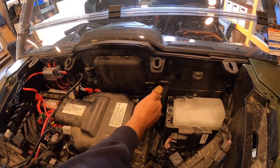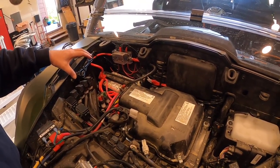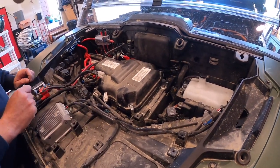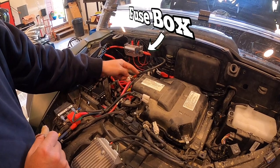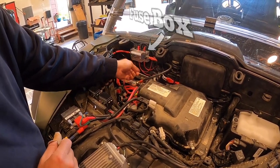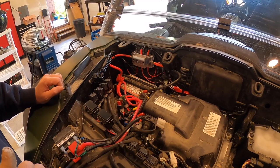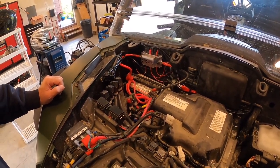There's a relay here for one of them — I put relays wherever I could fit them comfortably. So everything's on relays. All of that goes into a power box where I have feed into the battery, out of the battery, and then everything going to accessories comes out of that — all separately wired. Seems to be working fine; I haven't seen anything not working on it, so I think I might have done it right.